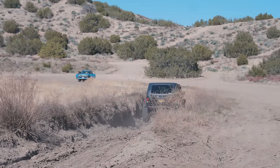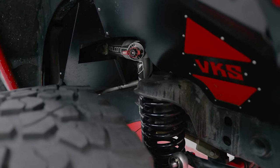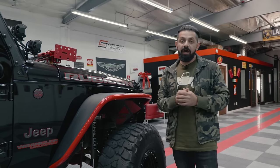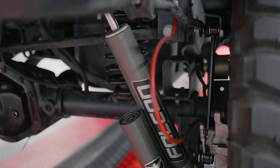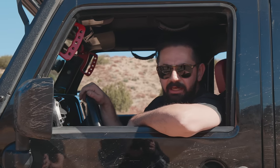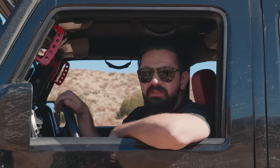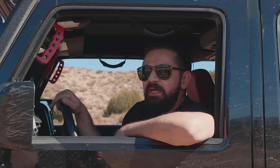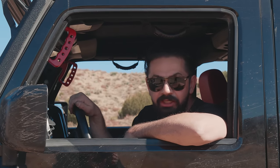After we nailed the steering, I wanted to jump into better shocks. I knew I didn't want to go with a coilover system since I was going to daily drive it on the streets as well. The shocks we went with are Teraflex adjustable Falcon 3.3s — setting one is the softest, three is the hardest, and in the middle setting of two you can micro-adjust from roughly one through eight. The car drives amazingly right now. We've also lightened the Jeep significantly — no spare tire, no tire carrier, running a stubby bumper in the front and a light Poison Spider bumper in the back. The Curry 4+1 springs were too stiff for how light the rig became, so we swapped to EVO plush coils, which pair really well with the Falcon adjustables.